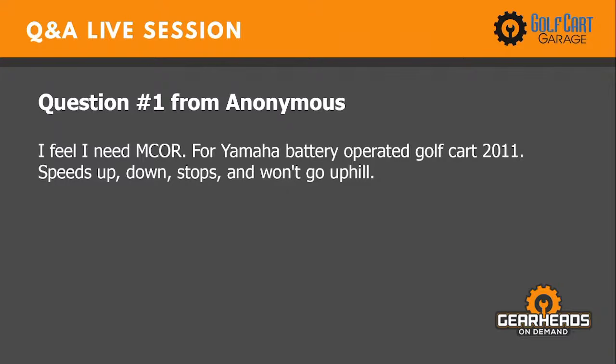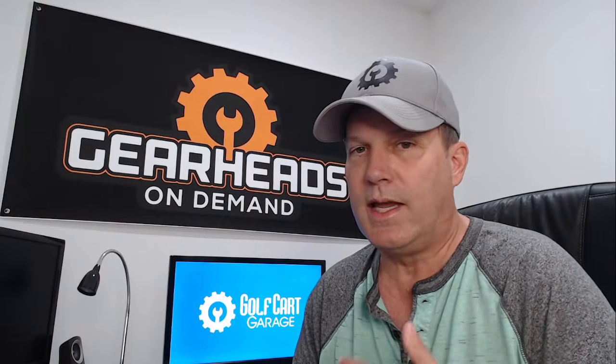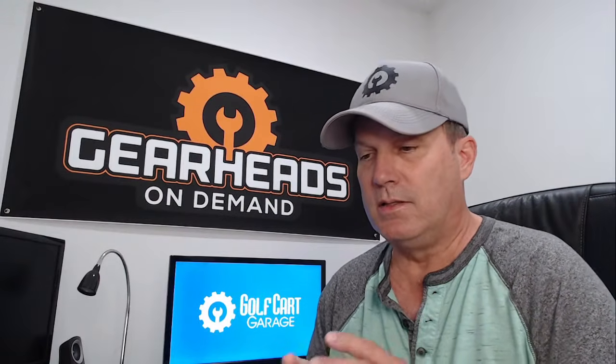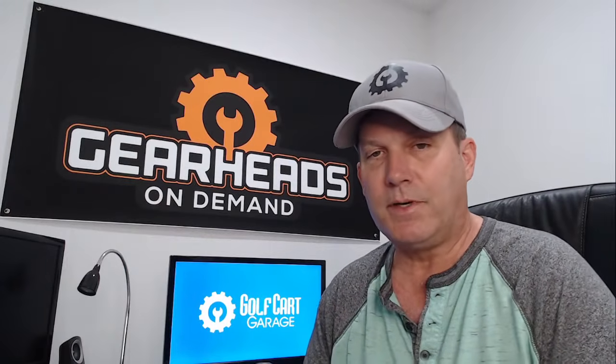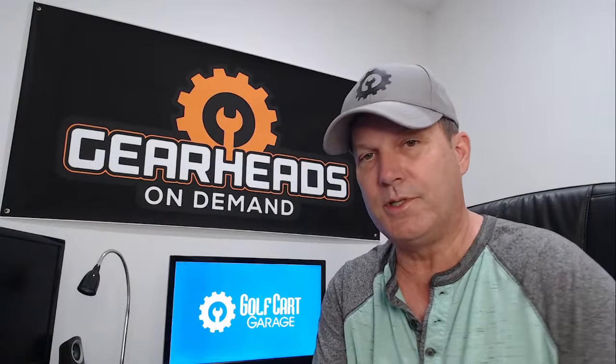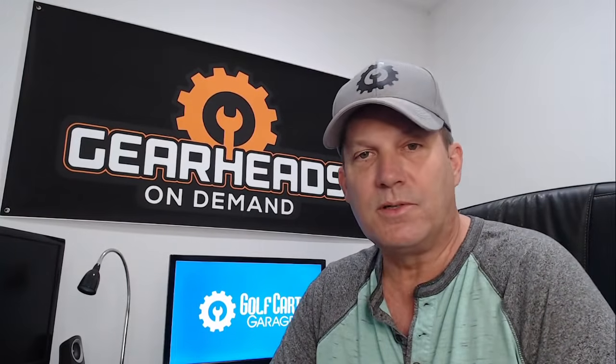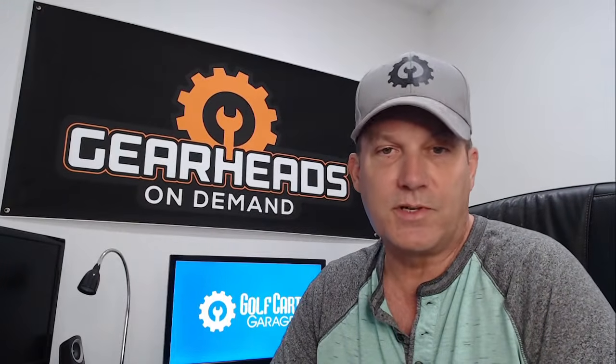Number one says, I feel I need an MCOR for a Yamaha battery operated golf cart, 2011. It speeds up, slows down, and won't go uphill. All right, well, Yamaha does not have an MCOR. All golf carts have a type of potentiometer. All the brands have some type of potentiometer. MCOR is specific to Club Cars. Yamaha's potentiometer is called a throttle position sensor.